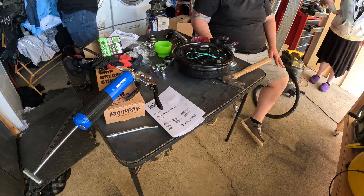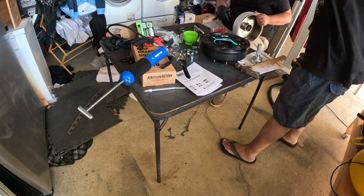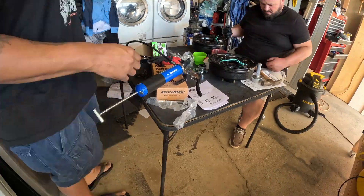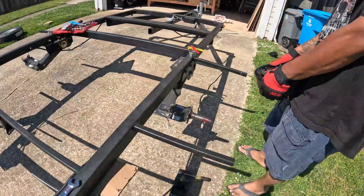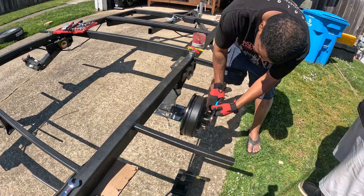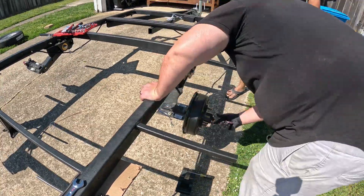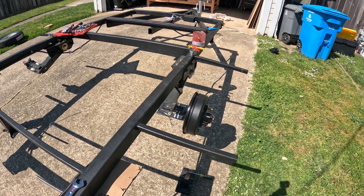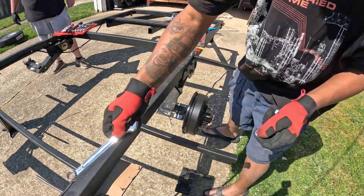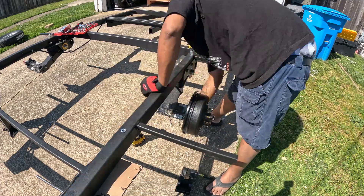The main reason I'm doing this is not just because it'll be harder to get into — I'd have to put in a step with the bigger ones — but the main reason is the back galley will have a countertop where I'll be cutting and chopping fruits, vegetables, and meat. Having it up too high makes it very uncomfortable, and it'll also be difficult to cook because the pan and heat from the stove will be much higher. So doing this lowered everything by almost six inches, which was significant.